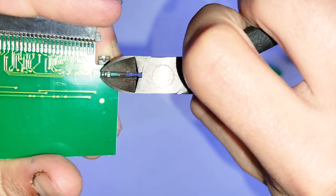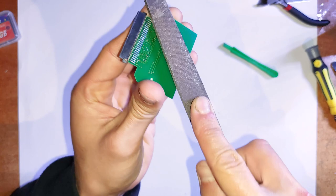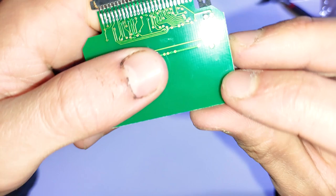whatever this thing's called. Yeah, the thing for sanding down sharp edges. Can't remember what it's called at the moment, but it does the job. Give you some sandpaper as well, I guess, but yeah, whatever. Just make sure you wipe away all of those little scrapings, because you don't want to cause any shorts with those, and make sure the blobs aren't touching each other. You can use a cotton bud and some alcohol. It's probably a good idea. Yeah, here we go.